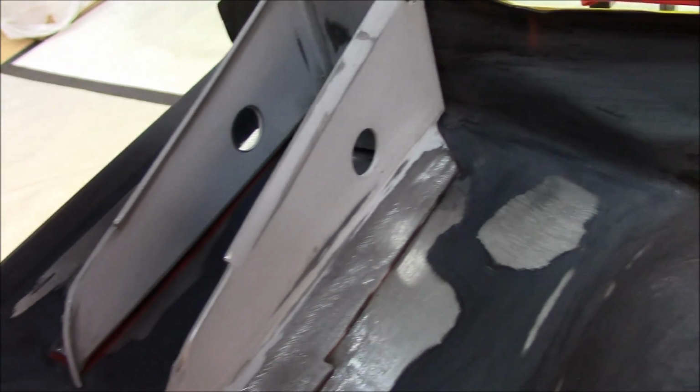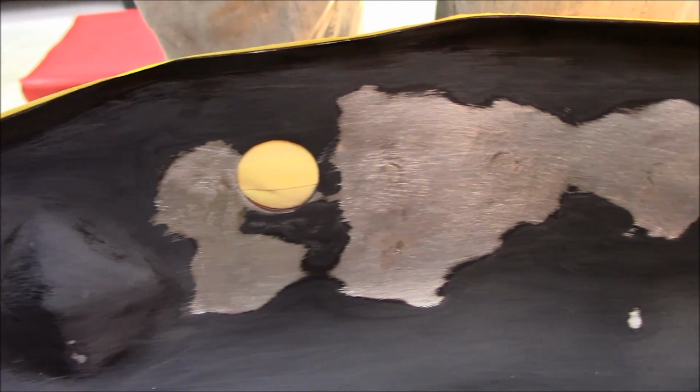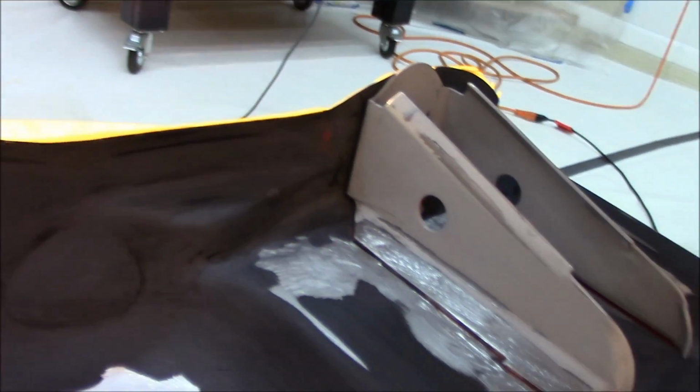We've got this area all prepped for some epoxy. Everything's been sanded with 80 and 180. So that's what we're working on, and we'll get you set up on the stand, see if we can't shoot some epoxy down on this trunk pan.